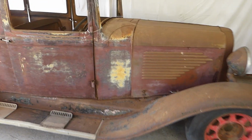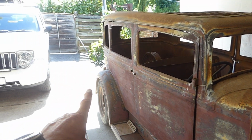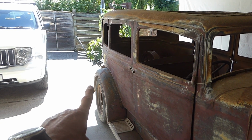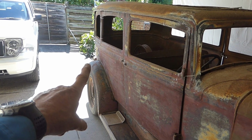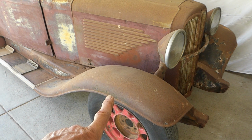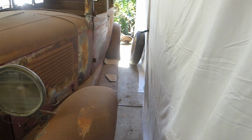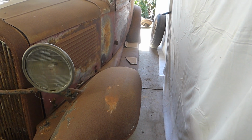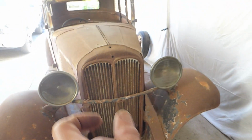Now, the biggest thing is to run the 300, to cover the track and have the tyre sitting like it is now, further right outboard like that, and that this part of the guard is the same width as what the 300 was. It needs to be 100mm wider there and 125mm wider at the front. It actually tapers in, but that guard has been rolled in. I've actually pulled it out a lot from where it was. I don't know if this side has got the same. So this hasn't been rolled in, so it might just be a case of doing 100mm all the way, and that's all it's done.